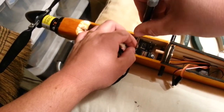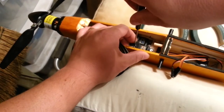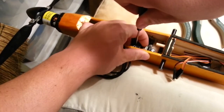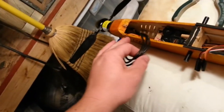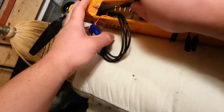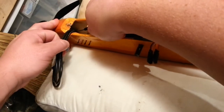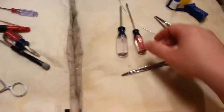You can see the two red marks are aligned properly, so we've relocated that onto the servo. Grabbing the magnet so we can throw it back in — that should mean we don't have any massive trim adjustments, usually maybe one position worth of adjustment, something like five to ten percent worth of clicks. You don't want to have all those clicks wasted. I'm going to try to free that without causing damage to anything.